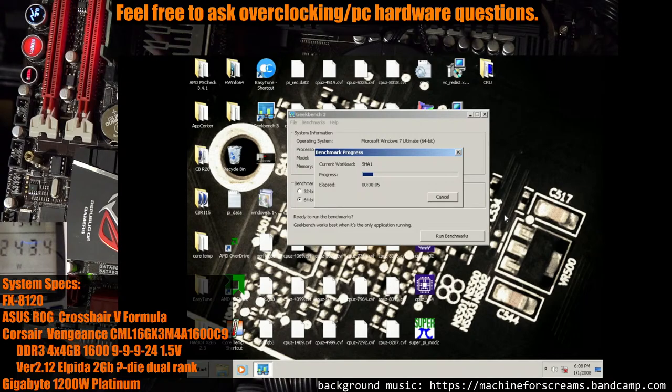So Samsung DDR5 is worse? No, Samsung DDR5 doesn't scale in terms of voltage, but it does pretty decent timings. I'm not sure how it compares to the newest Micron memory chips, but the original Micron memory chips are way worse. Samsung DDR5 does okay in terms of performance. It's just that with Hynix, you can keep raising the voltage and the timings keep getting lower, whereas with Samsung, you keep raising the voltage and nothing happens.